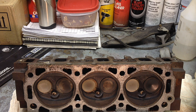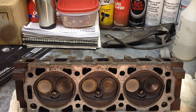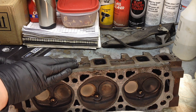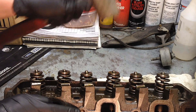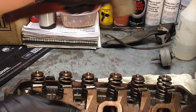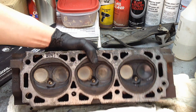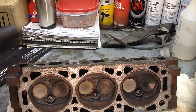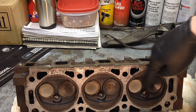We're going to test them on the bench here. We're going to give them a little tap of that rubber mallet on the top of the valve stems to make sure they're fully seated. Once they're fully seated, we're going to do a water test on these valves to see if they're leaking water through there.